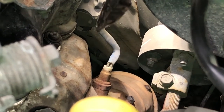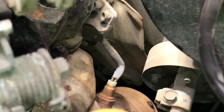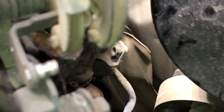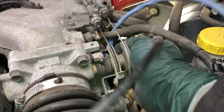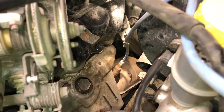With that throttle cable bracket out of the way, we can now focus on the little retainer there. Needle nose pliers can help you get that pushed out of there. We'll squeeze the clips in and then push it through. Now the blue cable should come out. Now we can work on the sensor removal, and it's not really any different than the passenger side bank one. We'll get the socket on there, figure out if we need an extension, and we'll break that free.